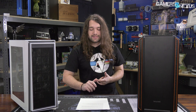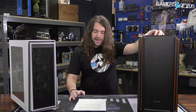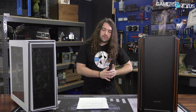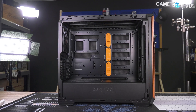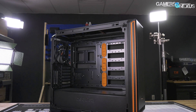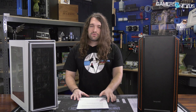Finally, the SP601 was tested at 83% fan speed with the front panel removed. This is important because it has the least variables. We took the same case and ran it with and without the front panel — but this time, we dropped the fan speeds low enough to equate the same noise level as when that front panel's on. So the only difference is front panel on versus off, the noise level remains the same, but the fan RPM drops to reduce noise through a more mechanical form rather than something organic and native to the case.